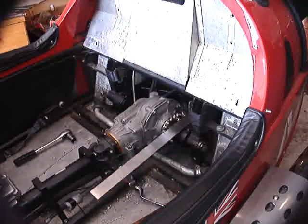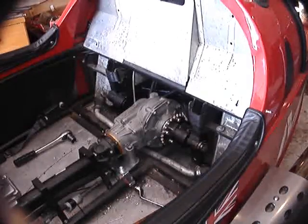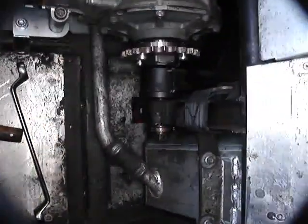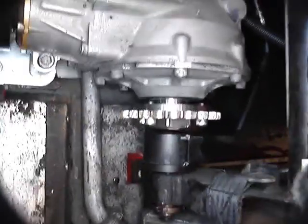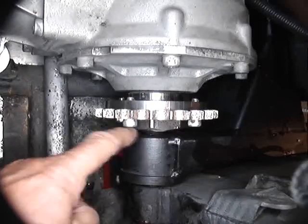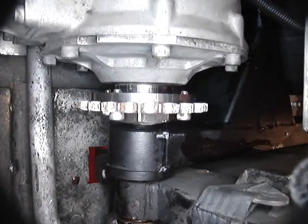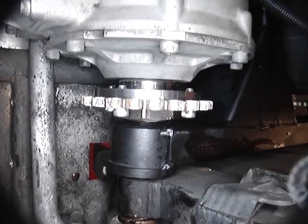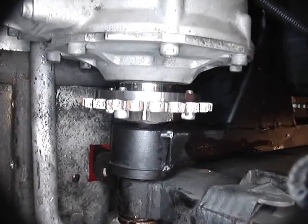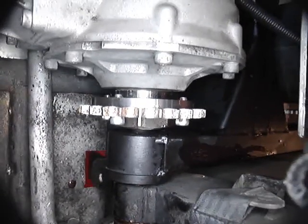So we can't just be moving the back wheel — swinging it left and right. What we can do, and you can see down there, is that there are just a few millimeters of clearance between the end of the bevel box output shaft and the swinging arm. The first thing I'm going to do is wind the swinging arm trunnions across to take up some of that free space.